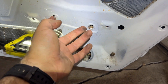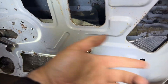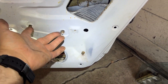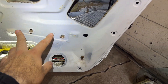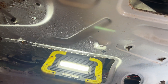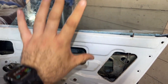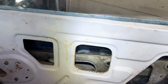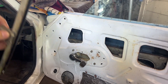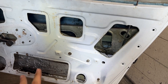Change of plans - I took off the window and went ahead and installed the little bracket for the bottom roller first, because the roller was on the regulator, not on the window, and I was struggling too much with the window in. Now that it's on, I can install the window. I put the nut on to keep it safer, and the window just fell into place on the rollers from the rails. Now we have to put in that last guide piece, and it's installed.